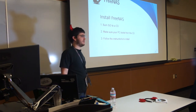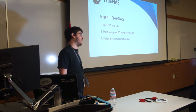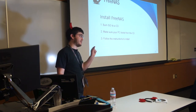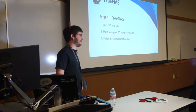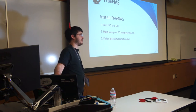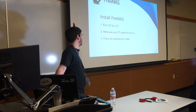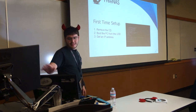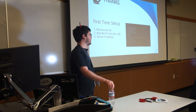Installing is really easy: burn the CD, boot the CD. There's going to be one instruction — which disk do you want to use? It's the small one, the 4GB one. It will wipe everything on the disk; this is not a dual-boot-friendly system. It's literally DDing the entire image over, complete with the file system layout. Nothing will survive. Just use a USB drive you never plan to use again. When done, reboot, remove the CD, and make sure you're booting from the USB.